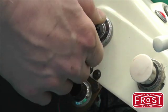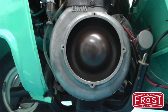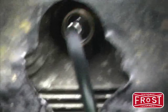Make sure that the engine is warm and will idle without the choke. Then look through the ColourTune straight into the combustion chamber. This orangey yellow flame confirms that the fuel air mixture is too rich.